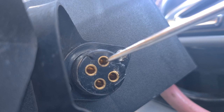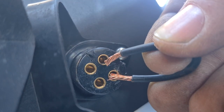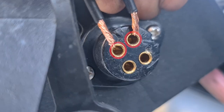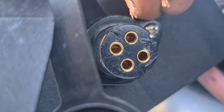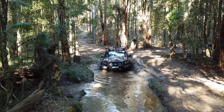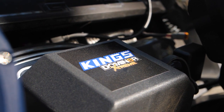With the isolator connected to the on position, use a paper clip to momentarily bridge the two terminals next to the small keyway cutout. You'll get a small spark and should hear a click as the relay engages — the winch should spool out. Next, use the paper clip to bridge the two terminals across the top next to the small arrow mark. Again, you'll get a small spark, hear the relay engage, and the winch should spool in the opposite direction. If the control box and winch don't respond correctly, it points to an issue inside the control box. Because these are mounted right at the front of your vehicle, they're subjected to mud, dirt and debris, and often the issue is as simple as removing the control box cover and cleaning with sandpaper and contact cleaner.